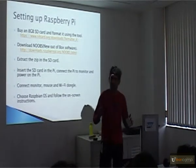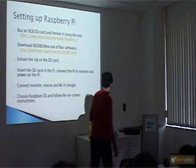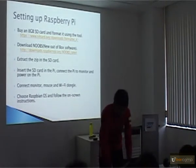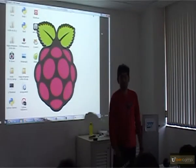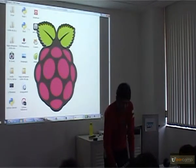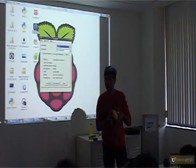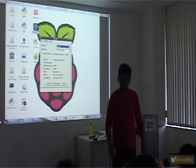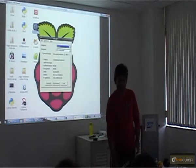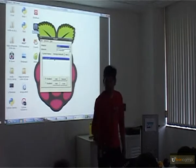I'm running a Raspberry Pi inside this laptop — this is how it looks via VNC server. I'm running from the Raspberry Pi and you get a desktop which has everything. For connectivity I'm using Wi-Fi. When you log in for the first time with the monitor, make sure you connect to the Wi-Fi, manage networks and add the Wi-Fi network. I've created an access point on my phone and connecting both through there.